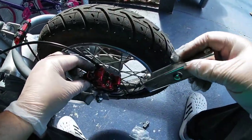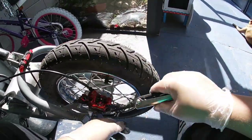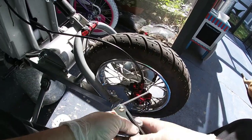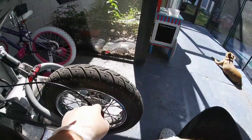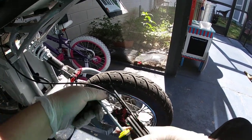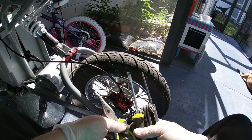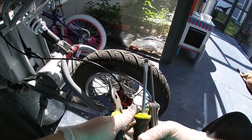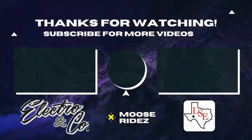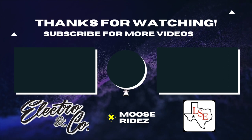Once it's not rubbing, go ahead and tighten everything up. Also check and tighten the brackets that hold the caliper on as well — don't over-tighten, just give it a nice snug turn and you're golden. All you need is an Allen key set, a flat head, needle nose pliers, and some gloves. This is a real simple job that should take about 10 minutes, and the same process we did on the back applies to the front. If you have any questions, leave a comment below — catch you in the next video!